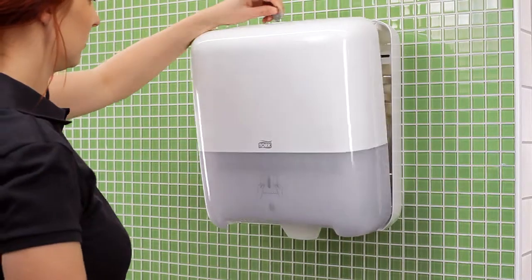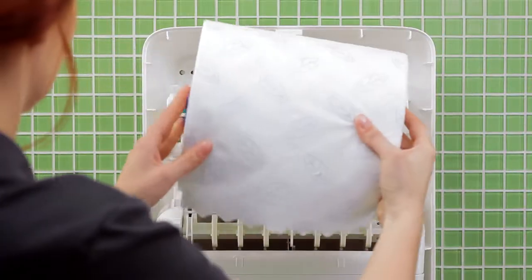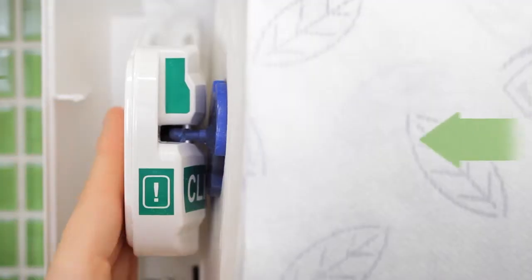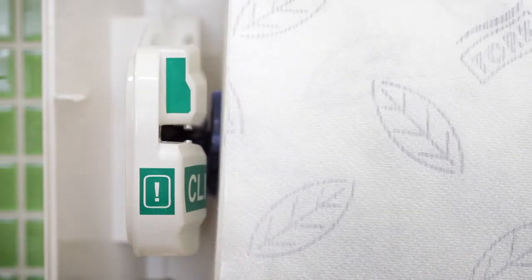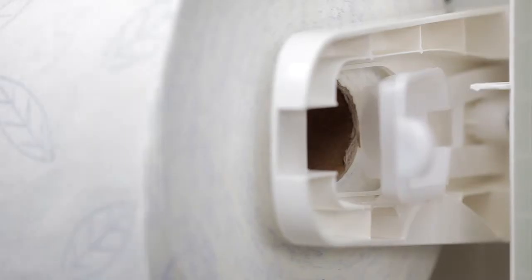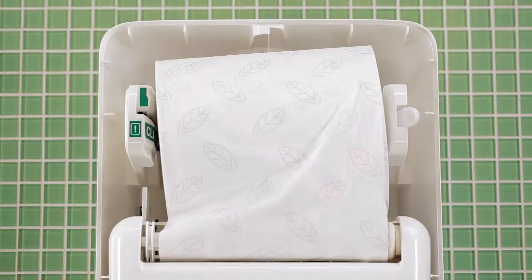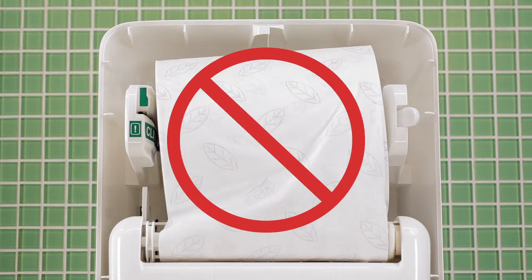Let's look at just how easy it is. Insert the roll and place the pin in the slot on the left side. Make sure the pin is in the slot and the roll isn't too far to the right. Check that the arm holds the roll. Push the roll back until you hear a click. Make sure the roll is not placed incorrectly, as this could cause paper jams.